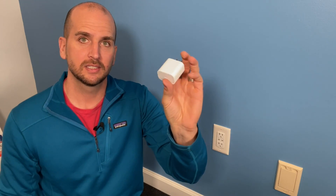So why are we seeing such a massive difference? Around 2017 and 2018, a lot of phones started to integrate different types of fast charging — they call it different things, but it's the ability to leverage USB-C and ultimately charge your battery faster. Fast charging has some restrictions: if your battery gets too hot, it shuts off; after 80% charge, it shuts off. But in our testing, since we were below 50% using an iPhone 12, the 20 watt adapter was able to deliver some of the benefits of fast charging. The USB-C integration in the receptacle gave us the same current or amperage as setup two, but it could not deliver the same voltage — only five volts — because that's the limitation of the hardware.